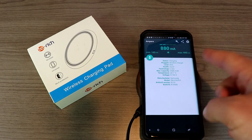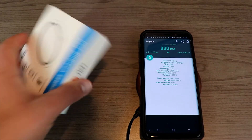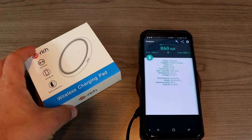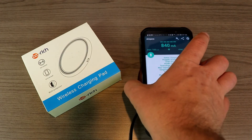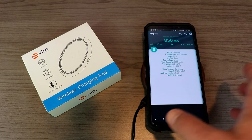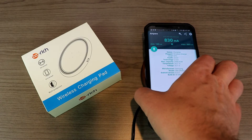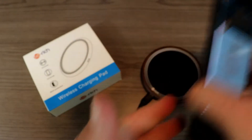That's actually a little bit faster than I would have expected for 83% battery. If the phone were completely dead, we'd get considerably faster wireless charging — this will get up to 1.67 amps. Also worth mentioning: any time you use a wireless charger, you want to use at a minimum a 2-amp wall adapter, and hopefully you have a fast charger brick. It looks like 880 milliamps was our max, which isn't too bad given the 83% charge level.